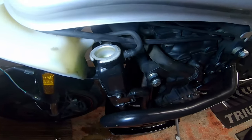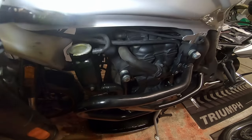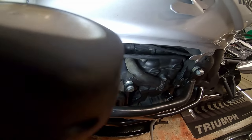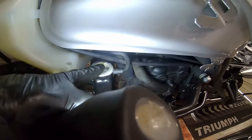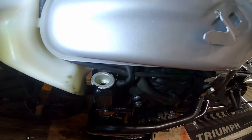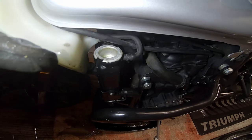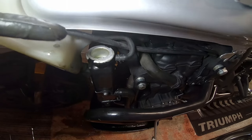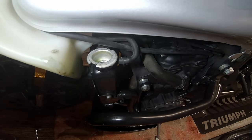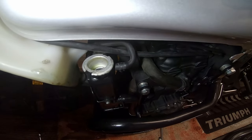With that screw back in place, we've got to put some coolant in - I'll need some sort of funnel because the tank is in the way. Leave the bleed screw on the other side undone to let the air out, and slowly fill this up until you can see the coolant at the top of the radiator. Then check the bleed screw side to make sure you can see coolant there too. If you can't, you need to use a pump or something to draw it through - do not use your mouth, you'll regret that, you'll be ill.